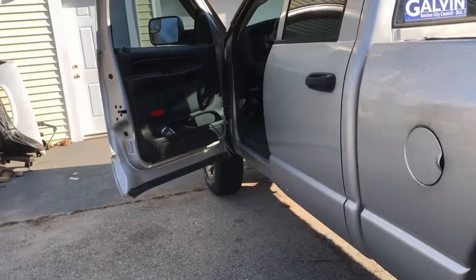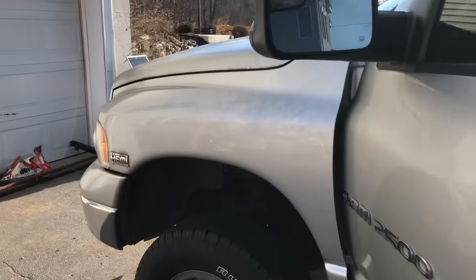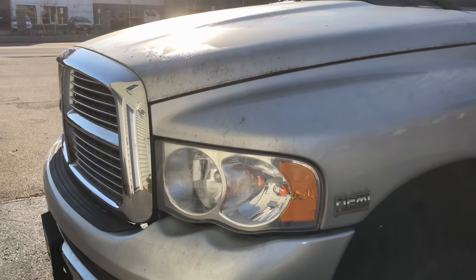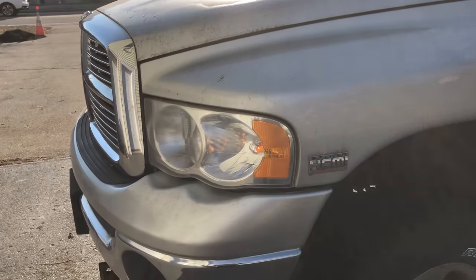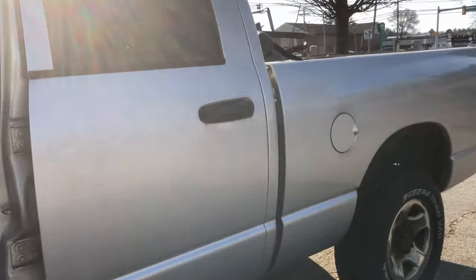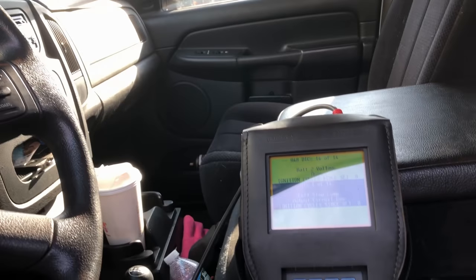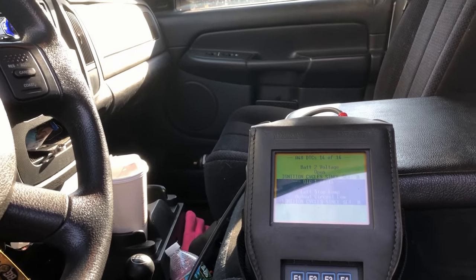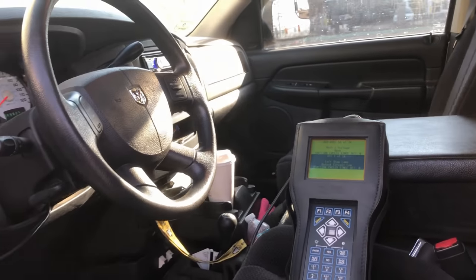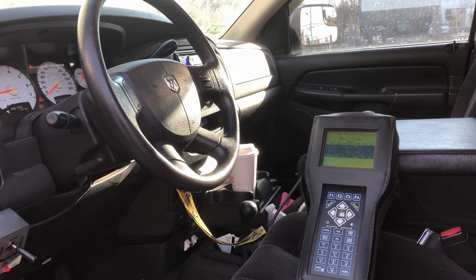I've already done some circuit testing on this the other day. We checked the circuitry in the left front headlamp and we actually found a bad connection where the plow adapter was put in. We fixed that, but the fault still remains, so we have to dig a little bit deeper. I've run fault codes out of the front control module and we have a bunch of circuit low codes — left front marker lamp circuit low, left rear directional circuit low.